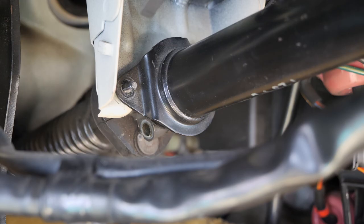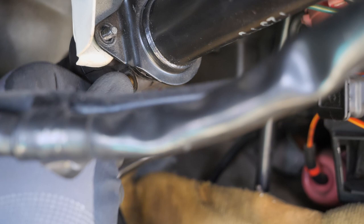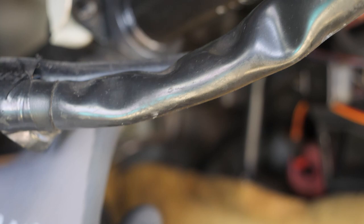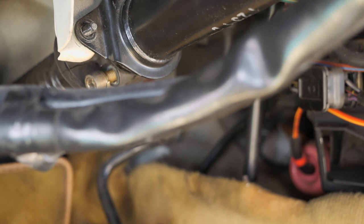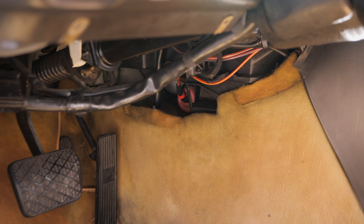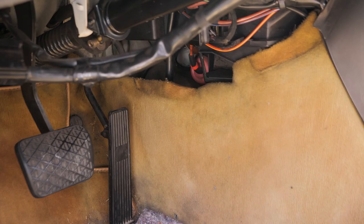The other thing I will say is that taking these nuts off of here, I don't know if loosening this did anything, but I think that loosening it from this flange gave it just a little bit more downward angle of the entire steering column, so that this was inserted into its hole, but you could actually drop the column enough that the lock end of it would be able to insert into the sleeve and finally get it to be in position. Then you can push that steering column up and then start fiddling with that pin.